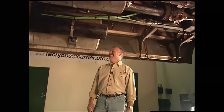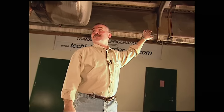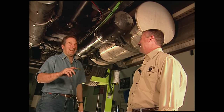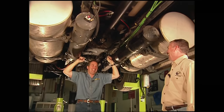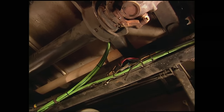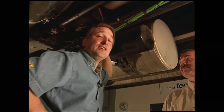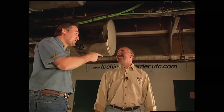We've got a couple of tanks here and Dan Johnson to tell us what those are. We've got some air tanks and some fuel tanks here. In the old days you could see those from the outside, but today they're covered by this skirting for aerodynamics and better fuel economy - keeps turbulence from going up underneath, just like a race car. Now, notice the transmission will not come out unless you take these tanks out first. We've all been there before. Then we've got this huge drive shaft and the carrier bearing. The frame is just an open C-channel. Dan, what's the deal with that? We don't want them very rigid - we're talking about carrying 80,000 pounds on these trucks. If they're very rigid, we're probably going to crack or break the frame, so you want that flexibility. Next time you see one of these things take off from the stoplight, watch that frame twist - there's a lot of torque going on there. You can see those cabs rocking.